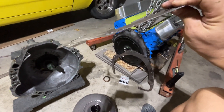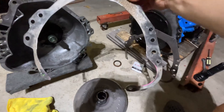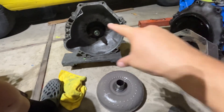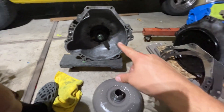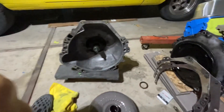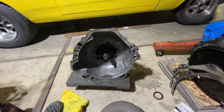Here are the two metal shims I made that'll help space the transmission apart about a sixteenth thick, same as the other separator plate that's on there. I did two of them, it should work just fine. I'm using RTV, a new gasket, new seal, and some good old assembly lube on there. Gotta put the torque converter in and hopefully it doesn't leak.